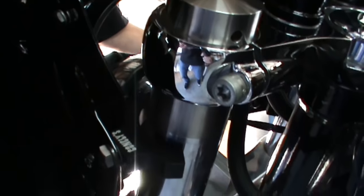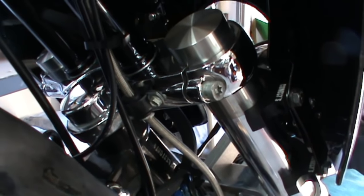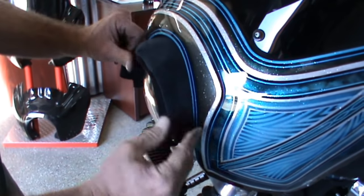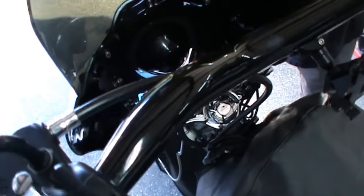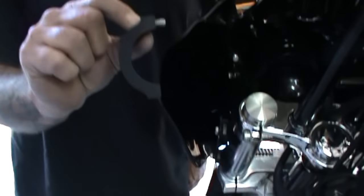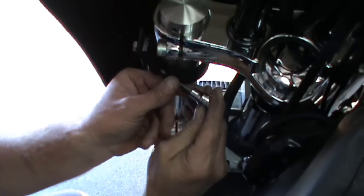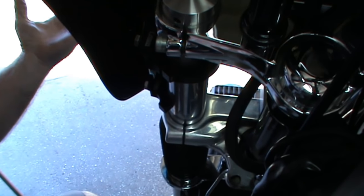Now, Ricky's fairing is just sitting there all by itself with that paint job. If you did it right, you should be able to do this. What I'll do is take this rag and push it into the hole. What that's going to do is allow me to get the fairing positioned straight with the bike, and protect the fairing and the headlight from separating. Give it a little separation, turn the handlebars all the way to the right. I start with one quarter-twenty and a small straight Allen — 3/16ths. Get the fairing so you can get one bolt snug and tightened. This way, the fairing can't fall and you can walk away from the bike completely.